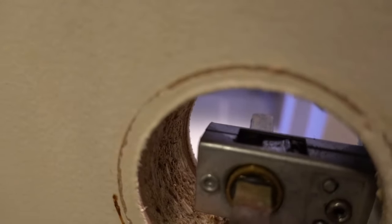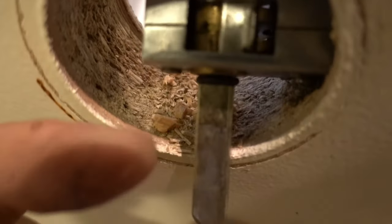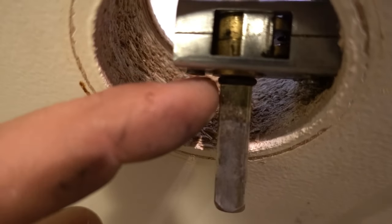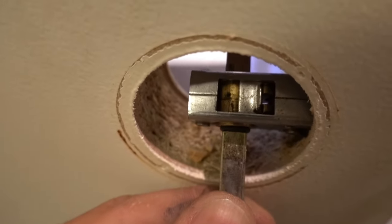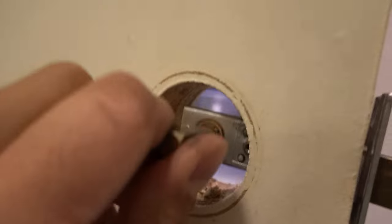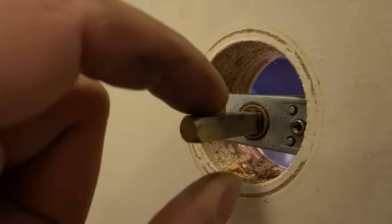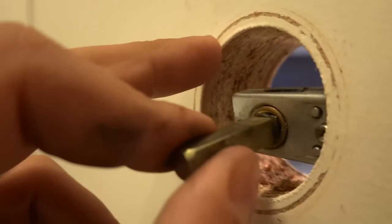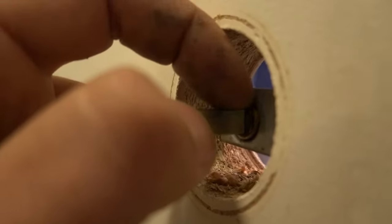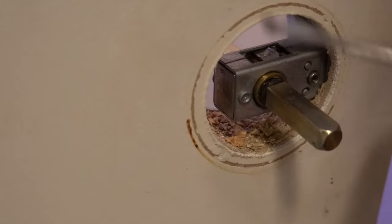So what is different about this latch? It's very difficult to see, but if you look right there — that's probably a better angle — you see that little black ring? What that is is an o-ring. For whatever reason, this particular lock has the shaft or spindle slide all the way through, then an o-ring slips over the top and sits in a little groove, doing the exact same job that a circlip would do. That little rubber seal is what's stopping everything from being pushed back out the other way.